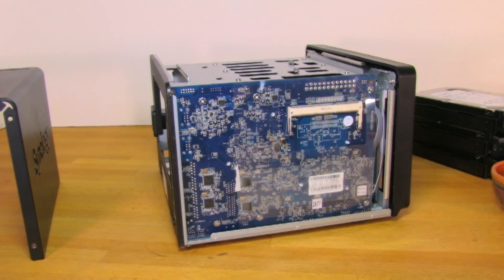Flipping to the other side, we can see the back of the motherboard and the additional RAM slot. The motherboard supports a full four gigabytes of memory; however, the DiskStation operating system cannot address more than three gigabytes — similar to running Windows XP or Windows 7 in 32-bit mode. So putting four gigabytes in won't benefit you beyond that three-gigabyte limit. Synology has mentioned they are looking into moving to a 64-bit architecture, though no timeline or additional details were provided.